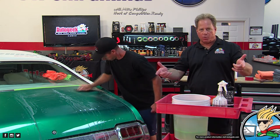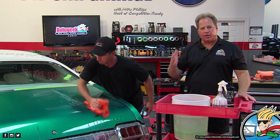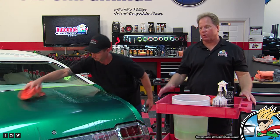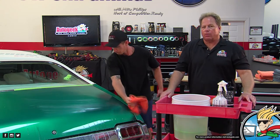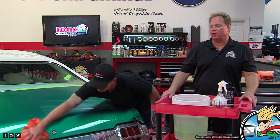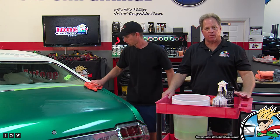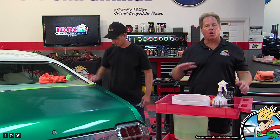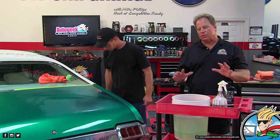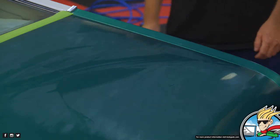If you sand dry, you create dust everywhere and you breathe it in unless you wear a respirator. And that fogs up my glasses, because I usually wear glasses for this kind of work since I want to see exactly what I'm doing. I don't want to wear a respirator and have dust all over the place. Also, your sanding papers and discs will last longer when you sand wet versus dry. They tend to load up really fast. When they load up, they quit cutting and start to mar the paint you're sanding. In my experience, there are more benefits to wet sanding than dry sanding.